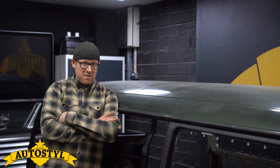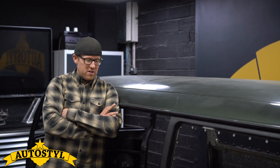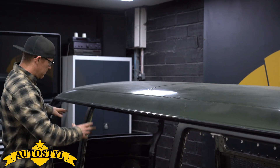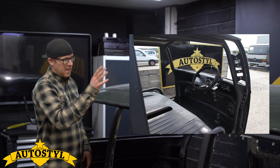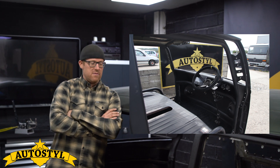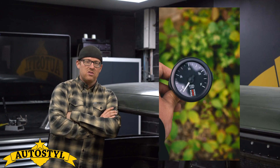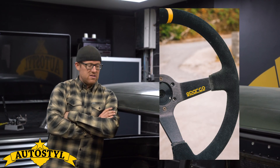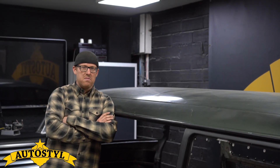The cantilever in the back is a nice little touch — it moves the air suspension into the vehicle so while you're driving you'll be able to see it all going on. The cage that's now out of the vehicle also becomes the dash, so we'll put some pictures up to show more detail on that. We're running stack gauges in the dash, all mounted off the cage — no excess padded dash to clutter things up, so it's quite a nice simple-looking build.